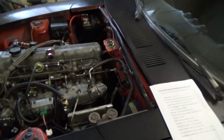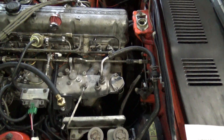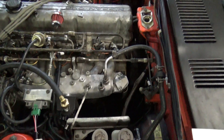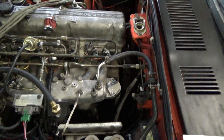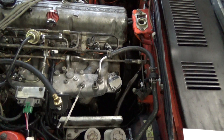First thing, I'm going to work from back to front. Down underneath in the exhaust, you'll have to install an oxygen sensor. They provide a bung — you drill a hole in the exhaust, weld the bung in there, and the sensor clips right in.